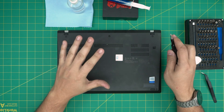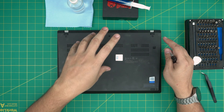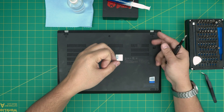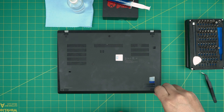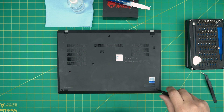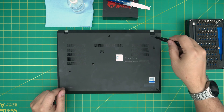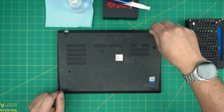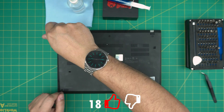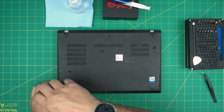First thing, you want to power down, flip the laptop upside down, and you'll see a bunch of screws. All the screws are the same size and height, but they will not come out entirely — there's a C-lock on the other side that prevents them from coming out completely. All you need to do is rotate each screw until it feels loosened up, then a few more rotations for good measure. Do the same for all screws, including the one in the middle. If you find this video helpful, support the channel by clicking like and subscribe — it motivates me to make more videos and answer your questions.